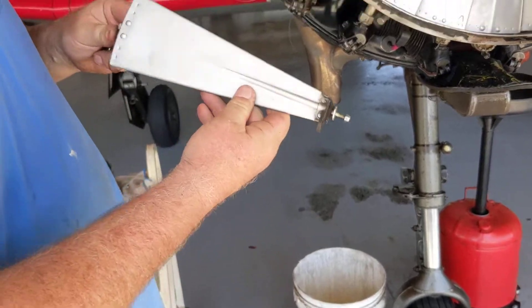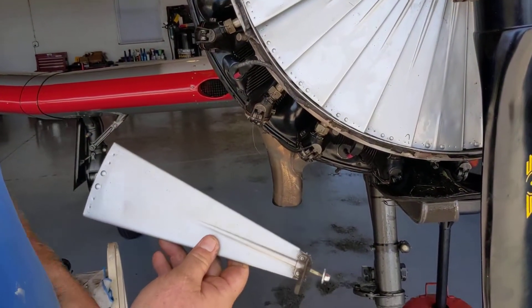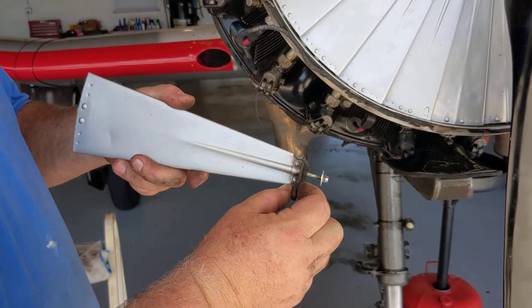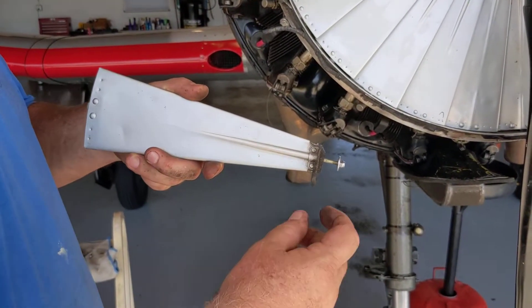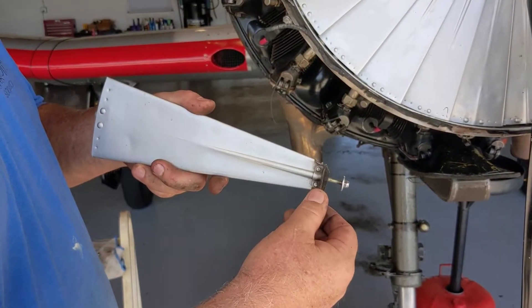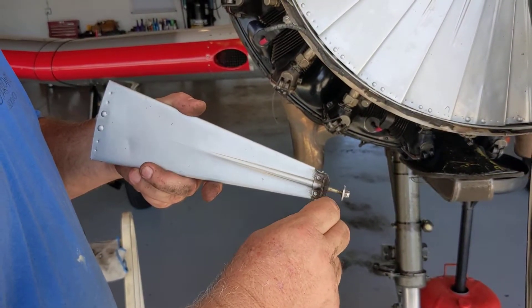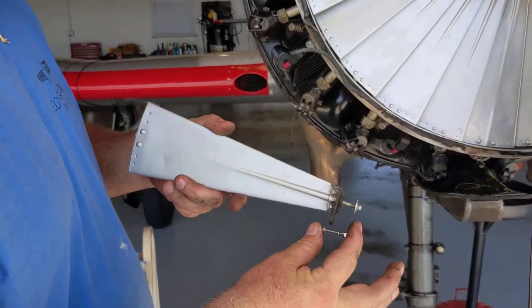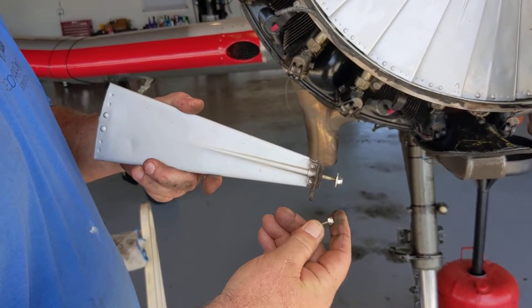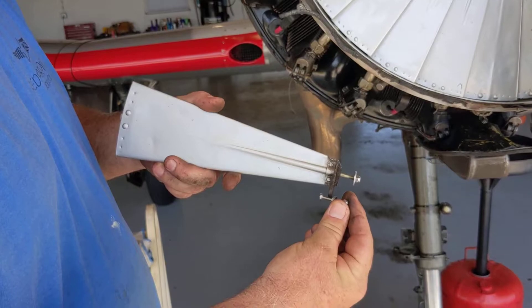And that's how it will sit inside the gill rings. The wobble plate screw has also been replaced. I found that most of those are worn out from being rubbed on by the wobble plate, so I went down to the aviation department at my local Ace Hardware and found a metric stainless screw to go through with a seven millimeter self-locking nut and also stainless washers to go on.